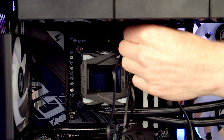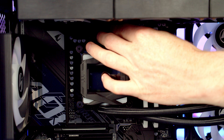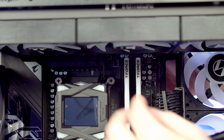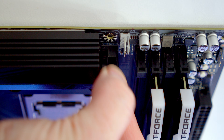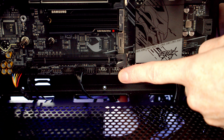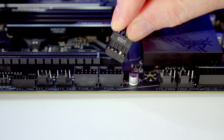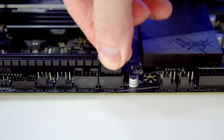Next I'm just going to route all the cables coming from the pump through to the back of the case. Just below our CPU fan header we've got our CPU opt header, so I'm going to pass the 4-pin PWM cable back through and get it plugged in. At the bottom of the motherboard we've got two USB 2.0 headers, so we'll bring our USB cable through and get it plugged in with the USB text facing upward.